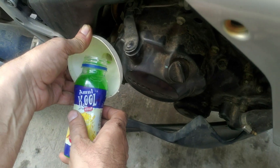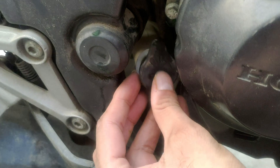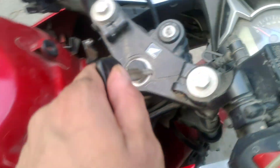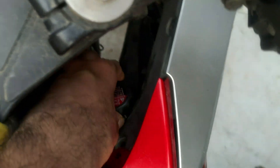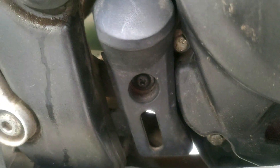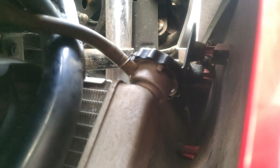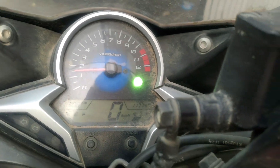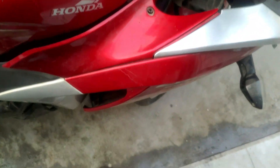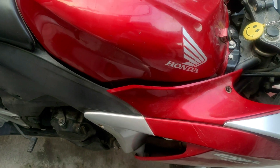The coolant has been filled — you can see the position of the coolant reservoir, the pipe is actually horizontal. The process is done. Let's start up the bike and see how it feels, and obviously we need to close the radiator cap. Now that the engine is running, I'm going to check the entire engine area for leaks — especially areas I opened like the engine drain bolt, the reservoir, the radiator, the pipe, everything. If I don't find anything, I'm going to rev the engine up and leave it to idle for about 5 minutes or so. Everything feels absolutely fine.